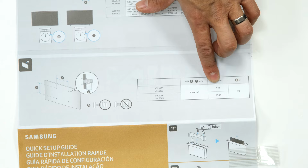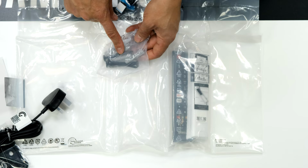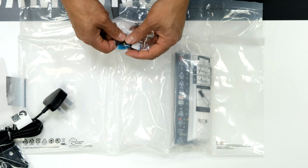Figure 8 mains lead, which we attach to the OneConnect box. It gives you a pack of wall mounting screws here, suitable maybe for a brick wall. If you've got plasterboard with breeze block behind, I'd use concrete screws or something. Wouldn't trust those so much going into a dot and dab wall, but use the correct fittings anyway, that's all I'll say. Or relevant fittings.